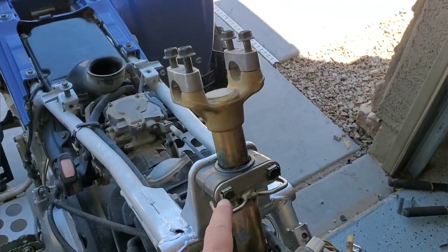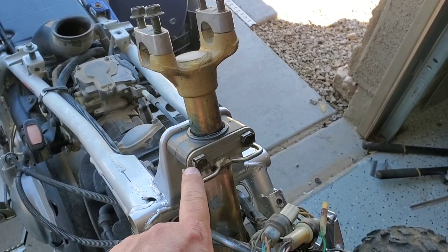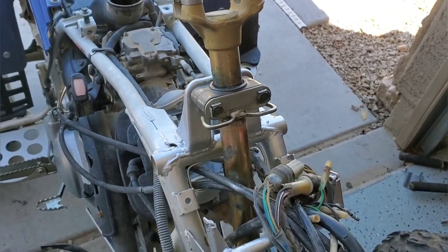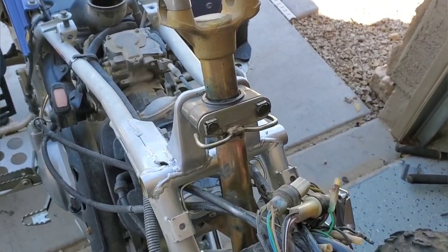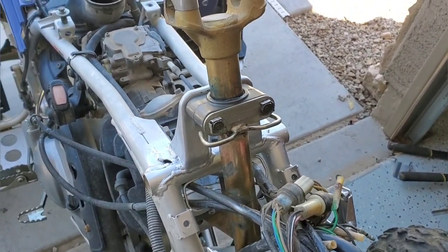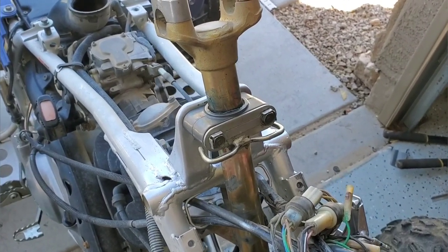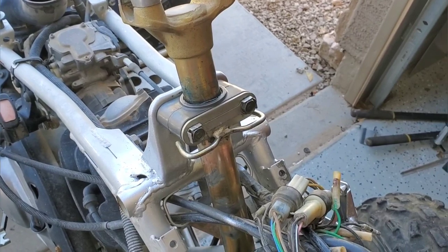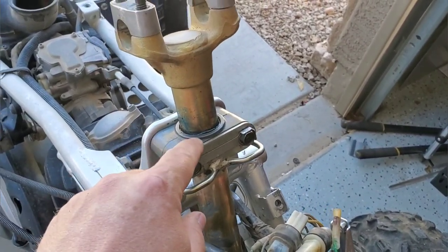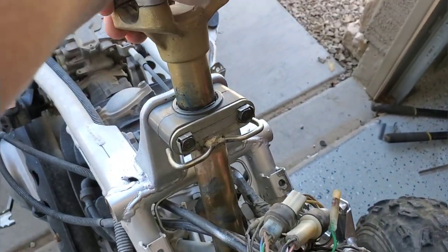The steering stem is installed. We have this little bend bracket where you actually have to bend the tabs onto the bolts once you get them tight. You don't tighten these down very much — you don't want to crush anything down. I put them at around 14 to 15 foot-pounds: a little more than a standard 10mm but less than really cranking on them. We got grease up inside; there are two seals that go in, and the turn feels good.